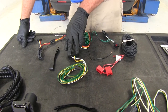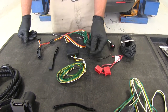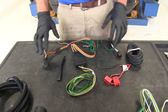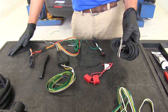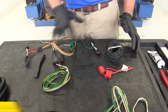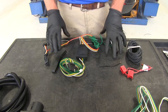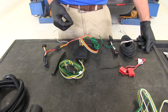One of the nice things about this box is it does receive standalone power from a 12-volt power source, so we're not drawing power through the lighting system, which might cause an overload situation. This is going to protect the vehicle's wiring system by getting its own 12-volt power from our battery. You can see they've got a bulk of wire here to help us run it up front, even a fuse holder and fuses. You'll need quite a few extra zip ties to do your installation so you can get it really nice and secure as it goes forward. This is definitely the most difficult kit to install, so hopefully you've got that factory plug underneath the rear of the vehicle — and again, most Traverses do have it.